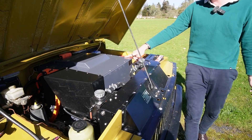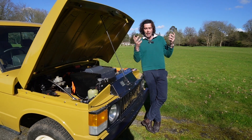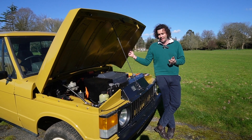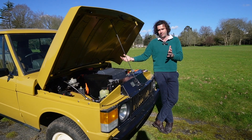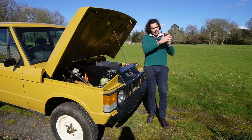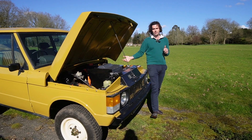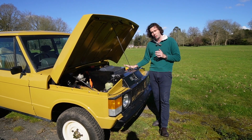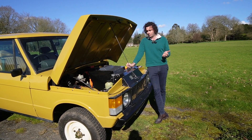One cooling system cools the battery pack - you're really only cooling it during charging. When rapid charging, you could be pulling around 200 amps into the battery pack constantly for 20-25 minutes, which generates heat. Whereas when driving, to maintain 50-60 mph you're not really using anywhere near 200 amps. So the cooling is primarily for charging.